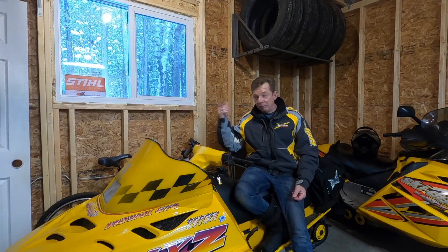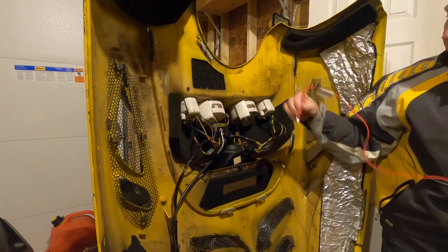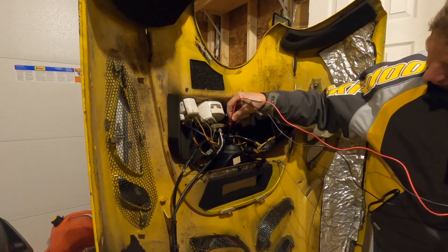If I had no volts, then I would be looking for a blown fuse or a busted wire. And if we were doing that test for a headlight problem because the lights were flickering or bulbs keep blowing — if you see voltage below 12 volts or above 15 volts, then the voltage regulator is probably going.